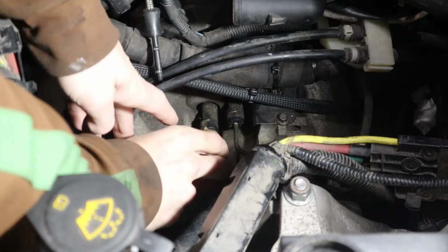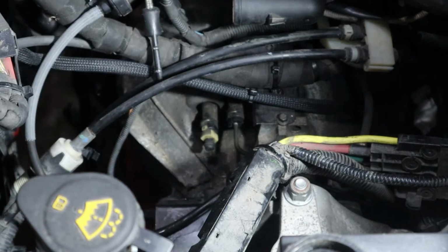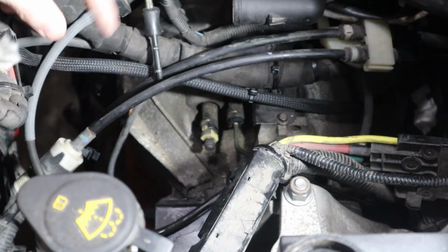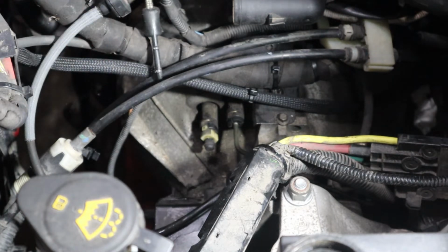Okay, that's been dripping for probably 15 or 20 minutes. So what I'm going to do is just make sure the clutch feels okay, and then I'm going to put the axles in and get the front wheels on, and the transmission and the shift cables, just so I can put it in gear, make sure the clutch releases nicely, doesn't drag or anything like that.